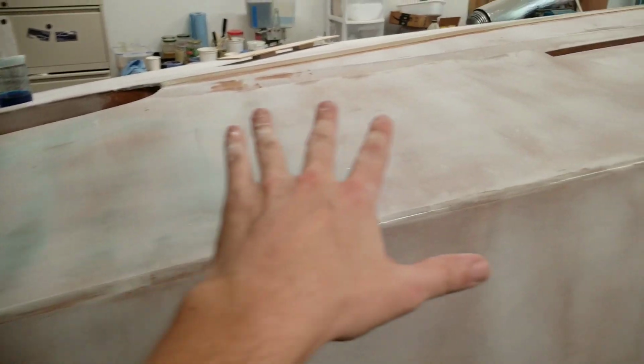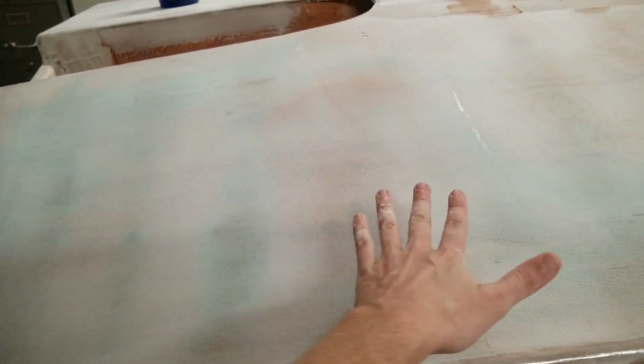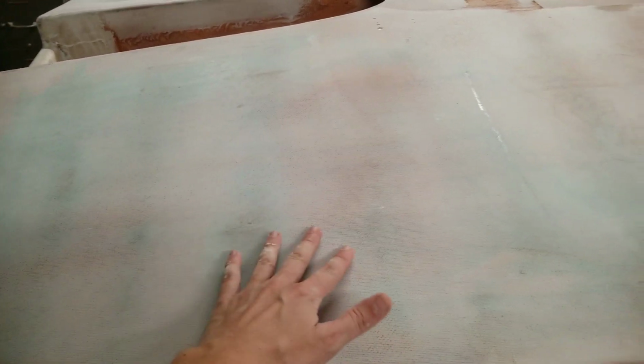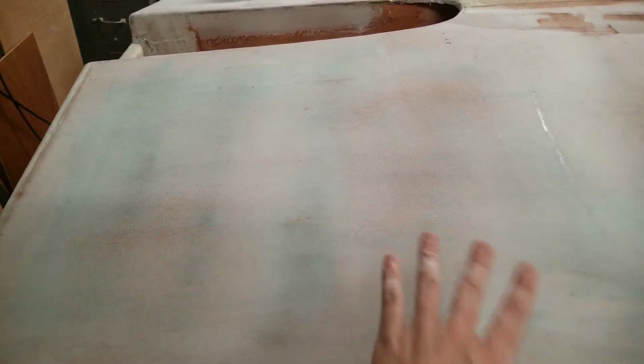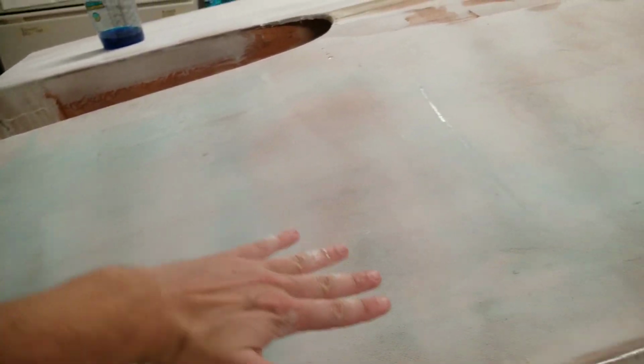The half sheet sander is really just smoothing. It's a difference between smoothing and fairing. Smoothing is, this surface is still slightly unfair, but it's smooth. But when you hit it with the board sander, you can see that it still has some low spots and some high spots, but the half sheet sander just follows those contours. So hopefully that makes sense.